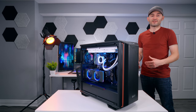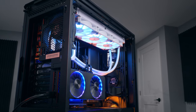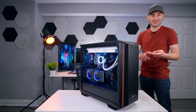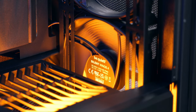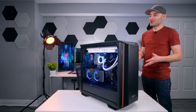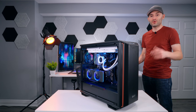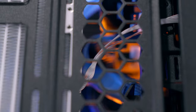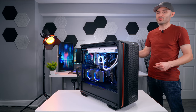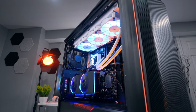Overall, building in the Darkbase 701 was a good experience. It's got a big, open, spacious interior and a well thought-out design that helps make the build process go smoothly and easily — exactly how it should be when you're paying for an upper-tier product. There's lots of cable management options, it can fit big high-performance hardware, the build quality is strong and solid, and it's highly versatile. The two real drawbacks are the limited storage space and the somewhat weird mounting system, plus no support for 420mm radiators — everything 360mm and below works, but certain combinations of thick radiators and large VRM heatsinks may cause clearance issues. With all that said, I think the Darkbase 701 checks a lot of the right boxes, offering premium high-end features in a smaller form factor at a lower price point.